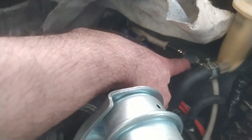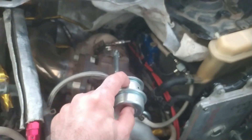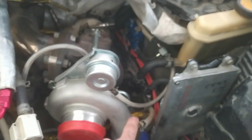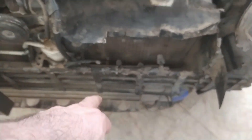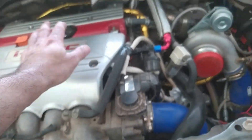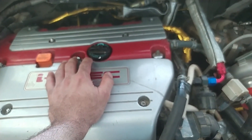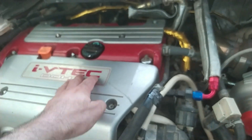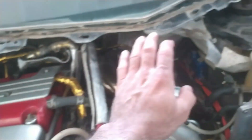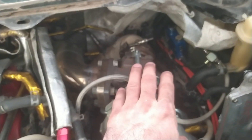When both are set to zero, all the boost is going straight to the wastegate — whatever spring is inside determines the boost. This is a 7 psi spring, and after the lag of the intercooler the actual boost the engine will see will be nearly 5.5 psi. So the engine sees 5 to 6 psi while the wastegate is fully opening at 7 psi.